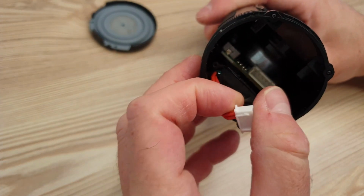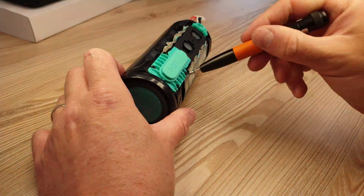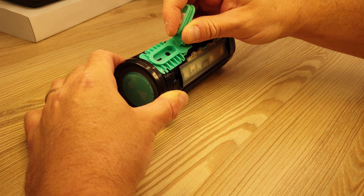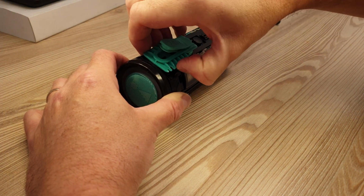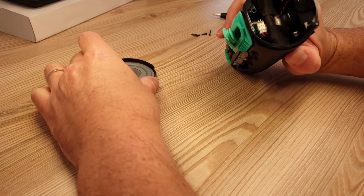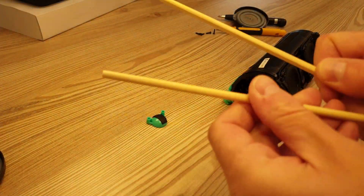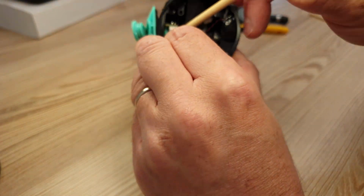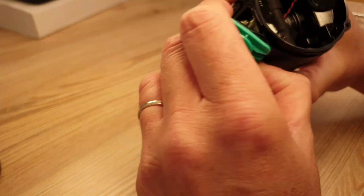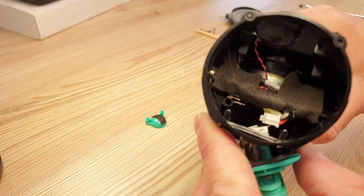If your battery is truly swollen, you will have some hard time pulling it out. You need to unscrew some more screws to be able to push the battery from the other side. Maybe the heat of my car is to blame, or maybe it's just the way it is and batteries swell up. Here I poke it with a stick and a screwdriver, but you should be much more careful. Only after bringing a friend to push, together we finally were able to pull it out.